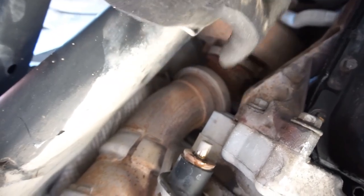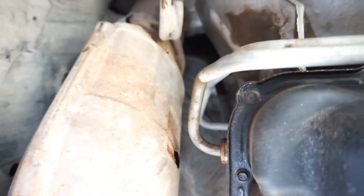You've got to take this V-band off up here. I had mine spun to where I could have access to it, so I'm gonna have to find a way to get in there and loosen it. You gotta take these two bolts out for this exhaust hanger. I gotta drop two bolts out of the cross member, one bolt out on that side so I can pivot this to get it out - those three bolts. Then I gotta try to slide it and separate it.